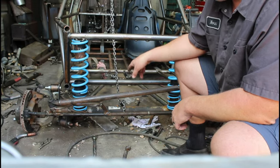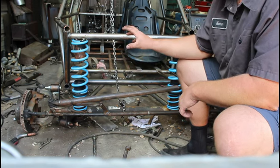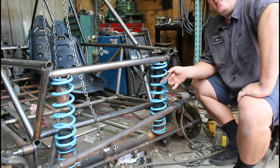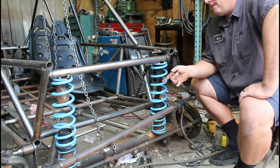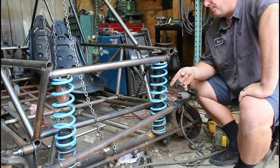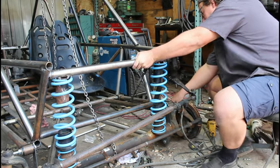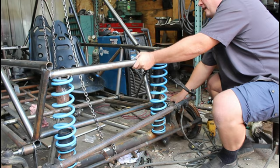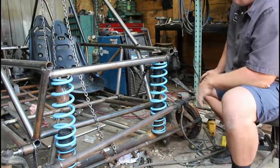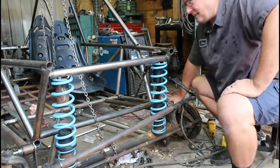Now, I think compact wise, that actually was the most effective way, but that presented a new problem. I did a single triangulated 4-link up front, and I did the triangle on the bottom because I figured that was the best place for ground clearance. And so far it's pretty good. Just grabbing side to side, there really isn't a lot of side to side flex. I still haven't finished the dual shears on the top links, so I know it'll rigid it up there. But as of right now, side to side walk, just me forcing it, there's maybe a 16th inch.